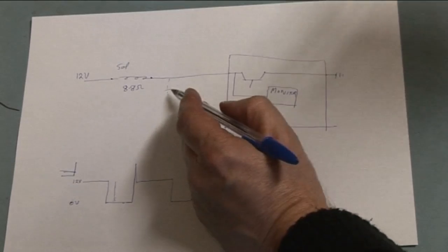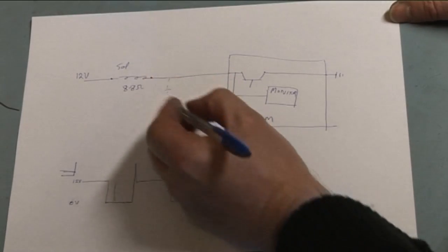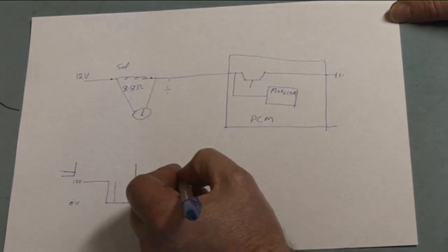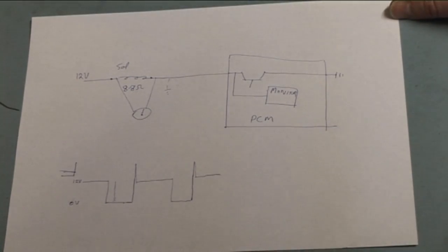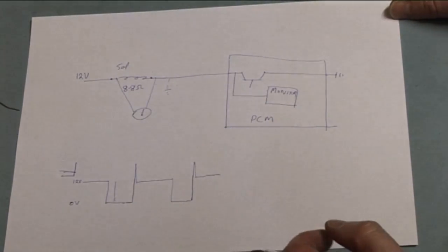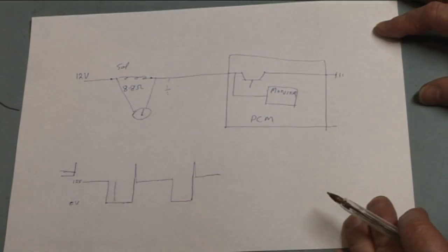What I did then was — I knew there was no short because there was no advance on the timing visible on the scan tool. I unplugged the connector and did an ohms test across the two pins of the solenoid, and that gave me a reading in the mega-ohms. I've replaced it with a new one and the measurement I get on the new solenoid is 8.8 ohms.